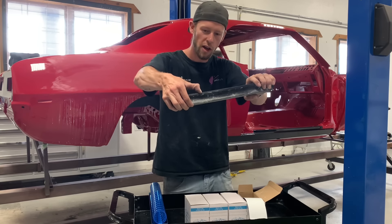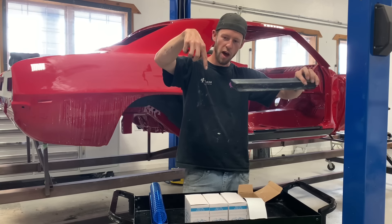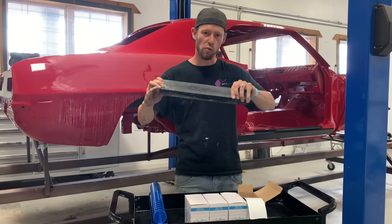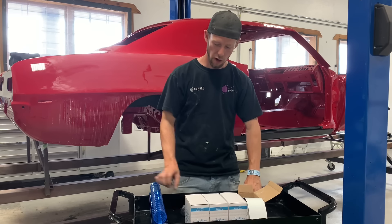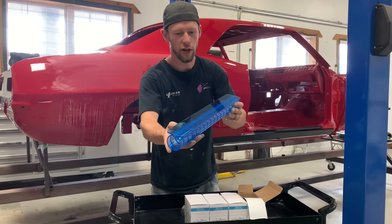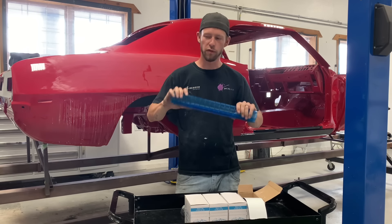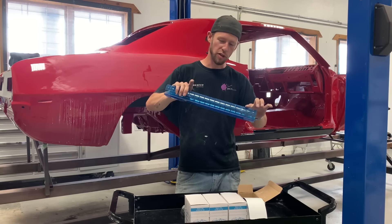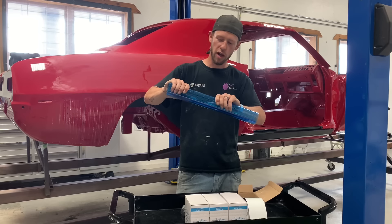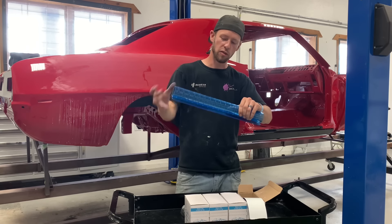Foam and rubber type blocks will absolutely lie to you, and the one main reason is they are not hard enough. To get something truly straight you have to use something harder than what you're sanding, and these foam rubber type blocks are not very hard. If you watch my finger, I can actually push a divot in the block anywhere. So when you're blocking a high spot, your block is actually compressing around it and not really cutting it. With a linear block, these are essentially like sanding with a piece of glass — very hard, very smooth, very flat, but flexible. They conform to the shape of the panel with even pressure distribution, and that's why we have what we call the vert grid design. You can put your hand anywhere on the block and it will distribute pressure evenly through its spine to the base of the block.